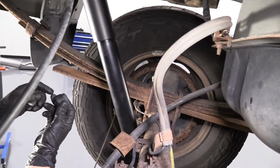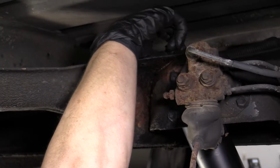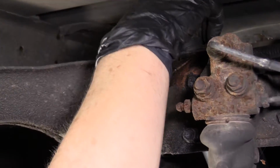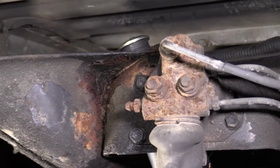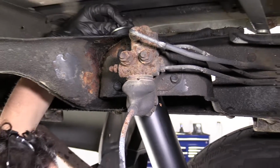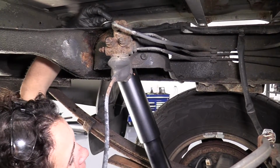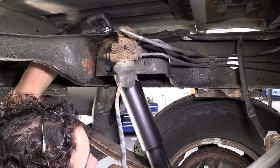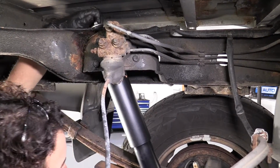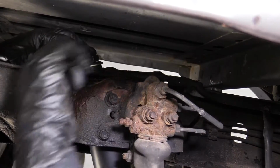Okay. Now I'm going to put the bushing on. Sometimes I spin it just to seat it. The flat washer. Now there's not much room up there, so I'm going to see if I can get a little bit of thread. Yep. I pushed the shock up. Now I can hand thread the nut on. Couple of turns. Here we go. Awesome. Now with a 14 millimeter ratchet wrench, I'm just going to start snugging up the top of the shock.